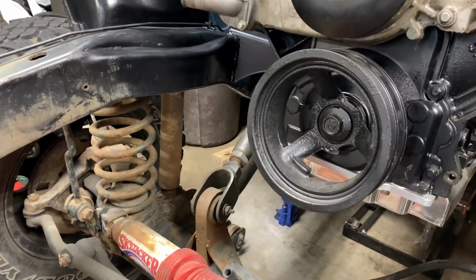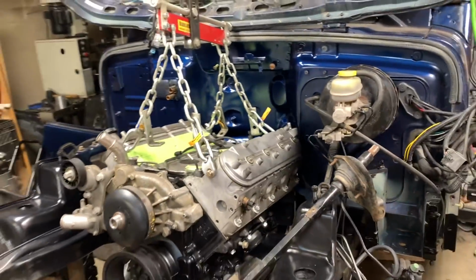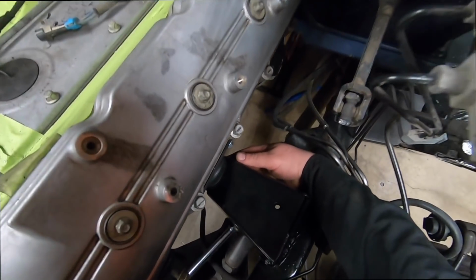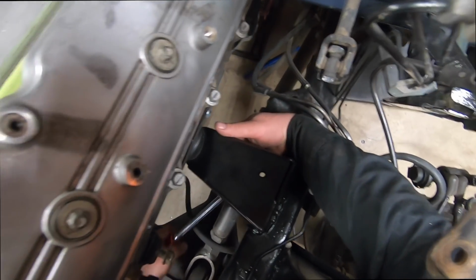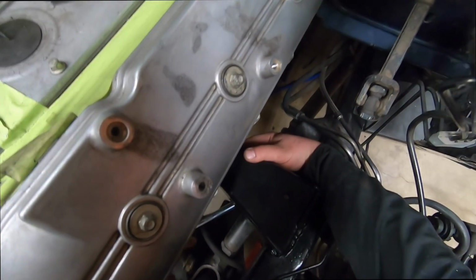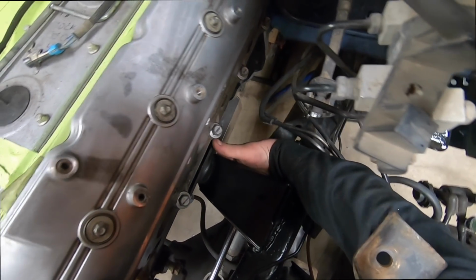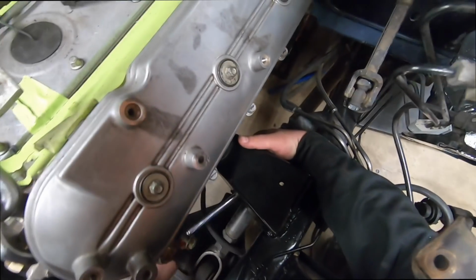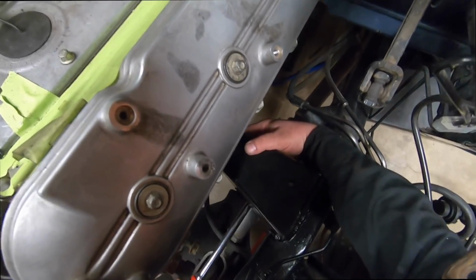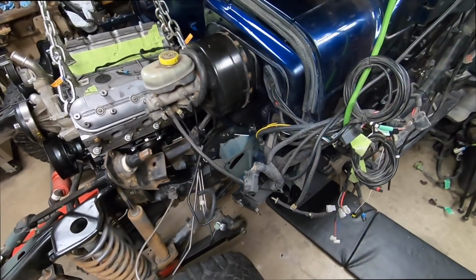So now I'm just gonna take the tension fully off the chains and finish tightening her up. So now I'm just giving the final tightness, and you don't want to tighten till the rubber splits. But I'm tightening up so they're snug and they're bulging a little bit. I'm taking my hand here, feeling around the bushing, our isolator, to make sure that it is seated in there good. And I'm pretty happy with that.